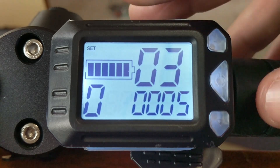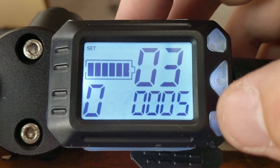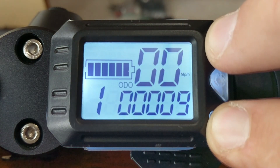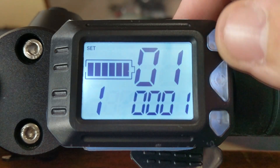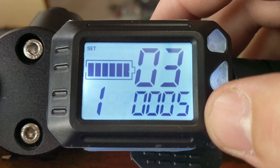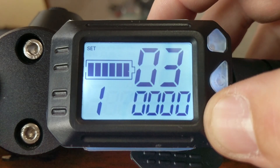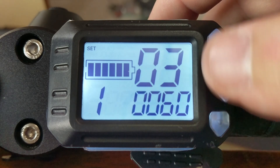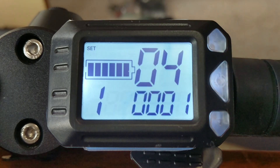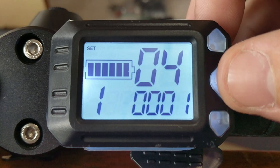P03 is an automatic shutoff for the entire system — not for the menu — in five-minute increments. It has a pretty quick timeout on the settings menu itself. I have mine set to five minutes. You can set it to zero so it never times out, or go all the way up to 60 minutes.